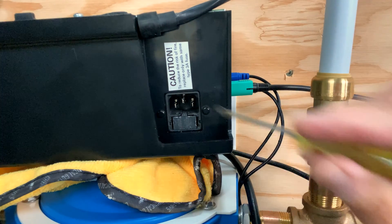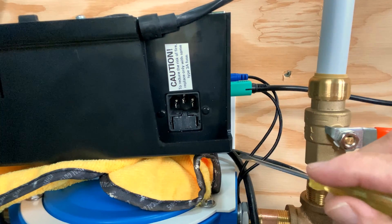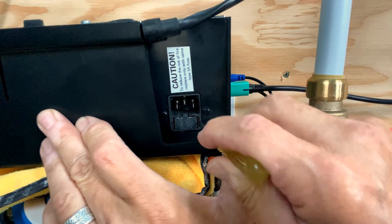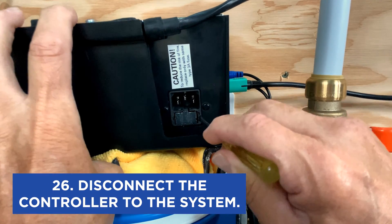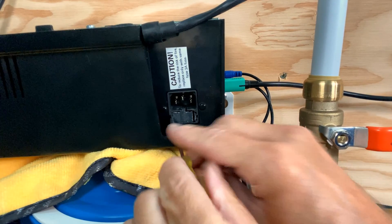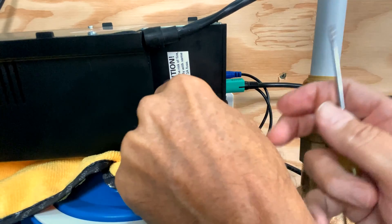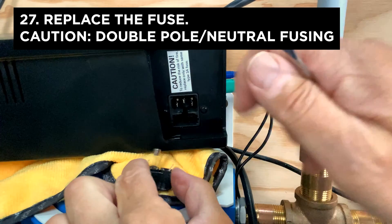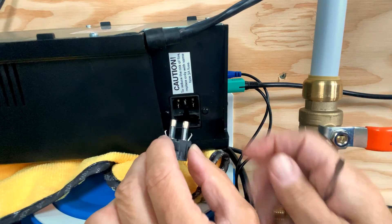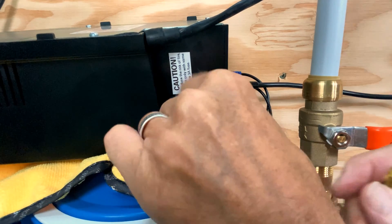The system has a couple of replaceable fuses inside the fuse panel, right beside where the power cord goes in. Opening the door is tricky — don't try to pry from the inside edge. Instead, go to the outside edge, insert a very small screwdriver from both sides, and pry it forward — the whole unit slides out. Inside you'll find two fuses rated at 3A. Slide the unit back in until it snaps on both sides.